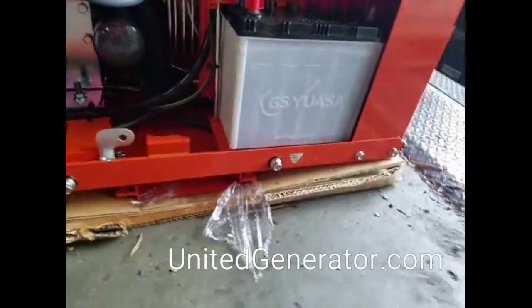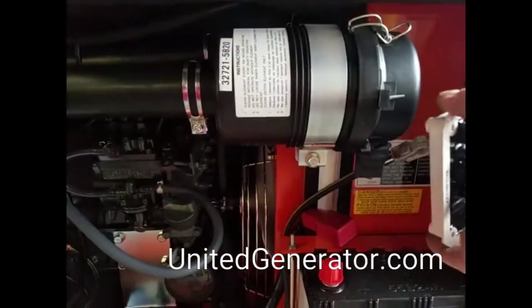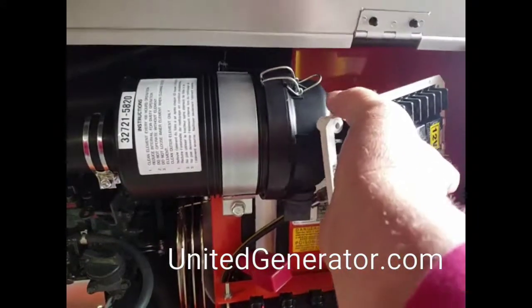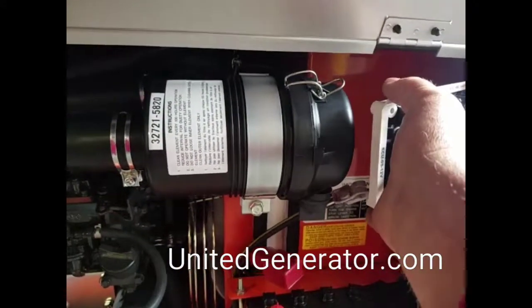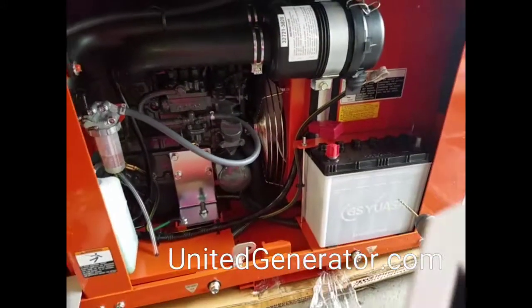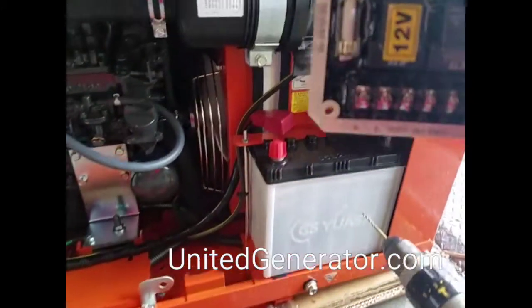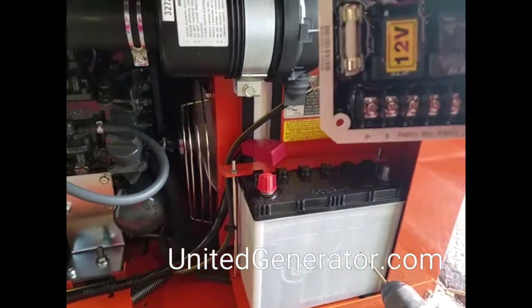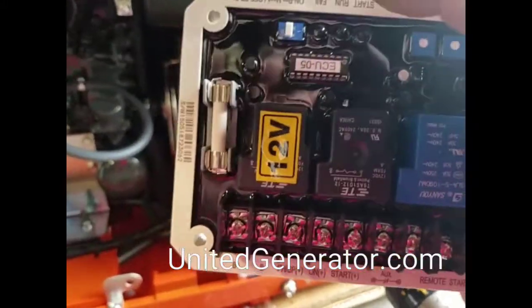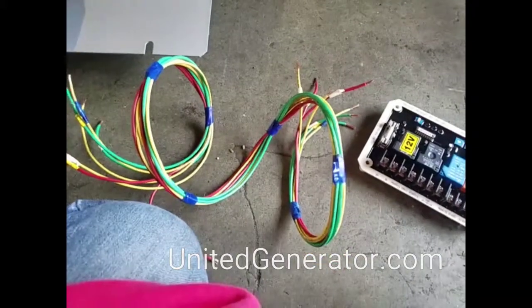The other thing I'm going to do is take the auto start and pre-drill it so that I can mount it with a screw instead of the ratchet gun. I don't want to crack this hard plastic when I'm attaching it, and I'm going to connect the wires when it's not installed because it's going to be easier to do it and then lift it up into place with the wires attached. So let's get on that right now.